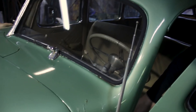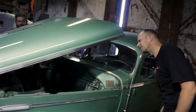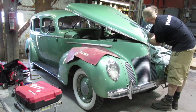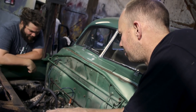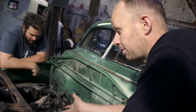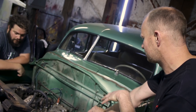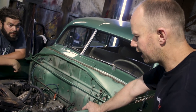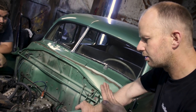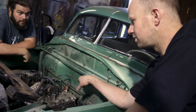First off, how do you get this thing open? This is the original six-cylinder flathead — very easy to work on because all the valve train is underneath. Since this is probably a '30s engine, I'm not 100% sure; I know they came with an 8 as well, which made them kind of unique. Hudson was one of the first to come out with a balanced crankshaft. They used to put lead in the fuel — lead protected the valve seats and was a very good anti-knock agent, which actually raised the octane quite a bit.